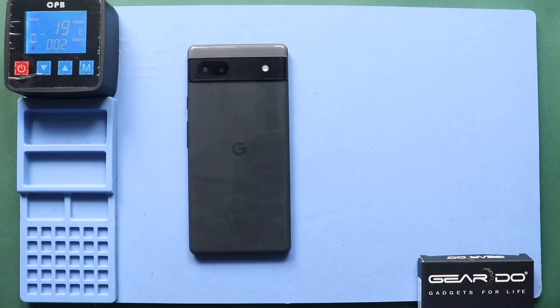The first step is to remove the LCD screen from the front. To remove the screen, it needs to be heated gently around the screen edges until the pasted adhesive becomes soft. For this, we are using a heating pad. Place the front screen side on the heating pad and select the mobile phone heating option and leave it till it completes. Alternatively, you can use a heat gun or a hairdryer around the screen edges.